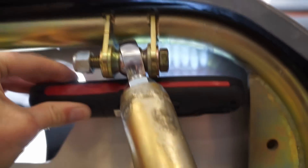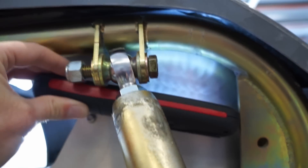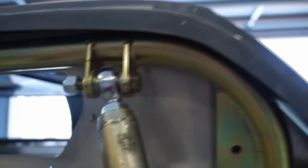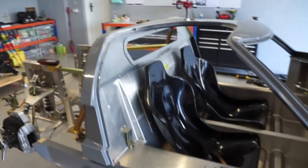The other thing is we are already maxing out after the cut that I made to the headwall — that's how much I trimmed off that corner. If I get a torch up in here you can just see that top corner is already maxed out again. So we'll have to trim that back a little bit more. It appears on the other side we're well clear, which is great. For now it's just trimming a little bit more off that top corner on both sides and hopefully we'll be able to get it to sit down — it hasn't really changed much in terms of the height off the sill, I guess it's still getting stuck on these lower corners. We'll make these cuts now and hopefully be able to drop that spider down so that it sits flush on those sills.